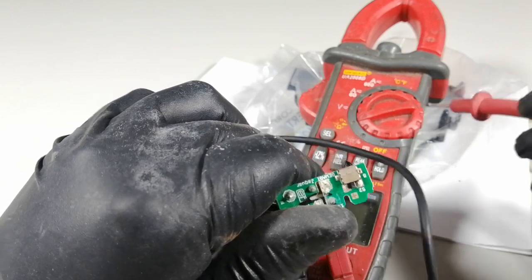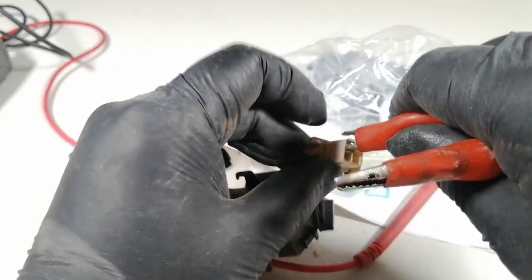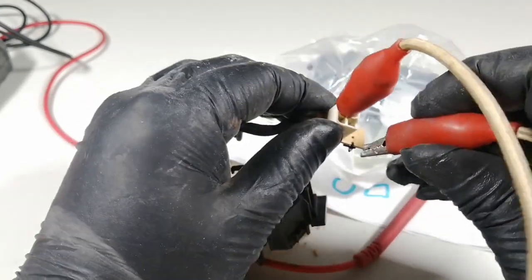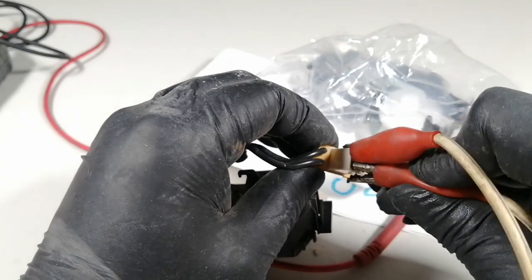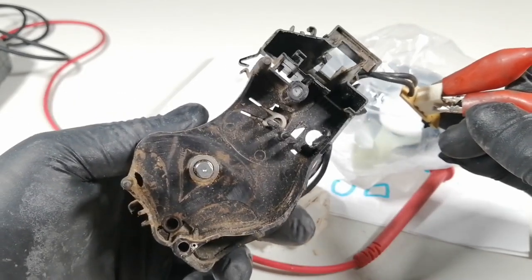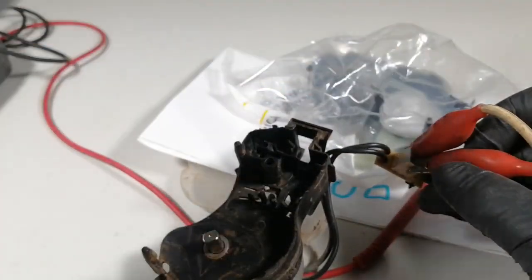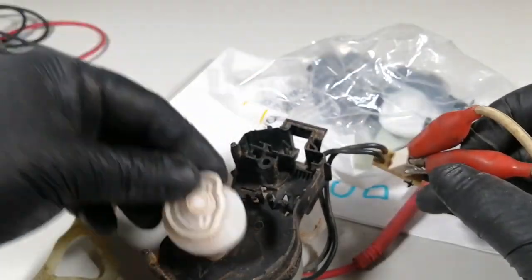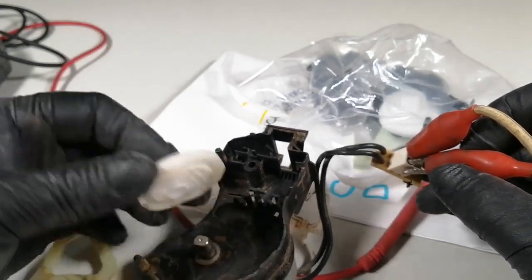Let's now test the motor. The motor, as I tell you, you can also test in series with the multimeter or directly at 120 volts. This one has to turn at the speed that is marked on the motor, how many revolutions it goes in each mode. I am telling you this in general about any microwave. Everything on the back tells you how many revolutions per minute it must give. If it does not give the turns corresponding to what the specifications tell you, replace it or change the actuator, because if it tells you that it must go 6 turns and it gives 4, it will never hit the position well. It will either take time, or it will be decalibrating every now and then.